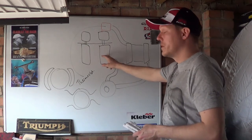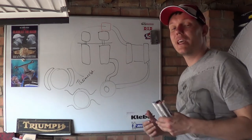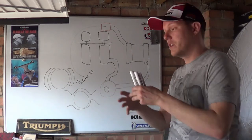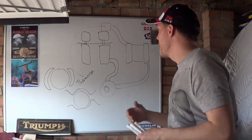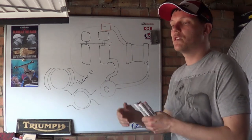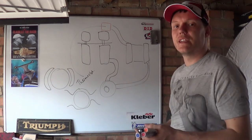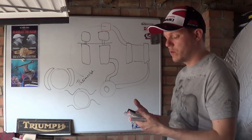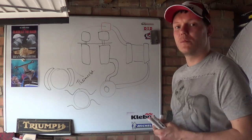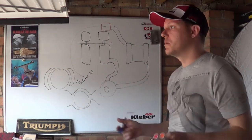So what we do is we use either air, with air cooling, we use the air as a conductor to basically take away the heat. We pass the heat from the engine to the air, and then colder air is there in its place, and we have a cycle that way. Then obviously if you want to make more compact engines or increase the power that an engine makes, which means you need to increase the thermal density, you then need better cooling. Air just isn't enough, so we use water. We use water because water is an excellent thermal conductor, and the amount of heat that it can absorb is one of the highest of any chemical compound in the universe as far as we know.